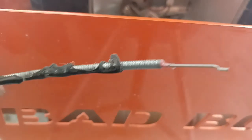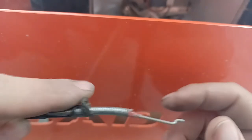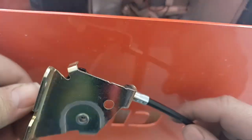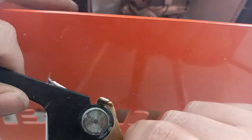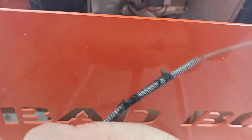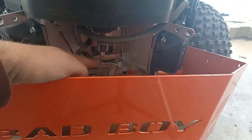Now that we have this out, we can take a closer look. As you can see, it heated up and melted right in there. I thought this pink was grease at first, but it's actually plastic, and that's what made this line very hard to move — it was locked up enough to break the wire up top. If the rubber coating had been cut off before it got to the engine, like back here before the heat zone, that would have been okay bare metal. Poor design overall.